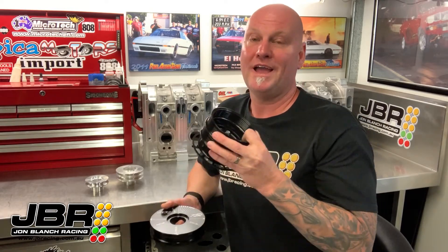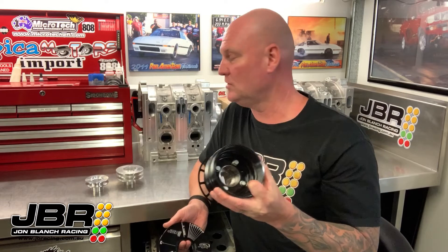Another thing — a lot of aftermarket ECUs won't retard the ignition timing any further back than TDC when you're trying to zero the timing. With the factory mark all the way back at 20 degrees after TDC, it's impossible to use that factory mark to accurately check the timing on leading number one. So with this tool you can make some additional marks on the factory pulley that will allow you to check the timing on an FD engine properly.